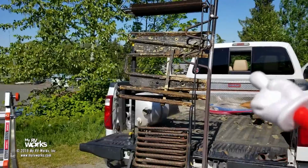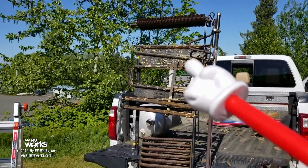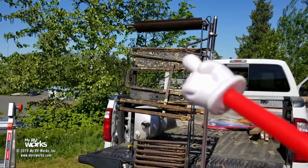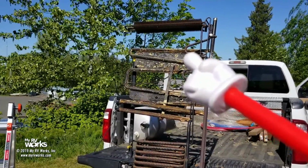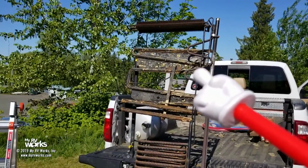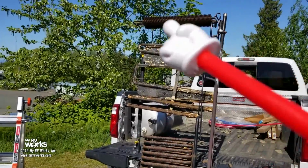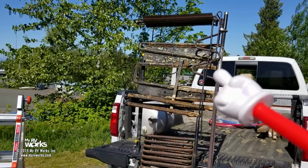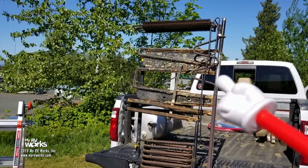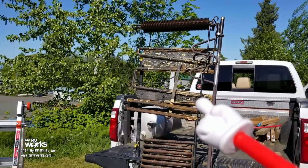The other thing I wanted to point out here is there's two heat exchangers going on in this evaporation. There's a gas heat exchanger up at the top where the ammonia evaporates into the hydrogen. That's a gas heat exchanger, and we are exchanging heat. We are absorbing the heat in the ice box and in the fresh food compartment. So that's a heat exchanger done in gas. The ammonia vaporizes, absorbs the heat out of the environment, and then it travels down.